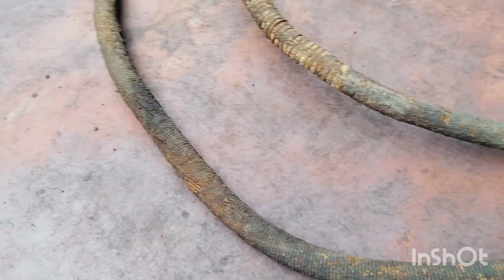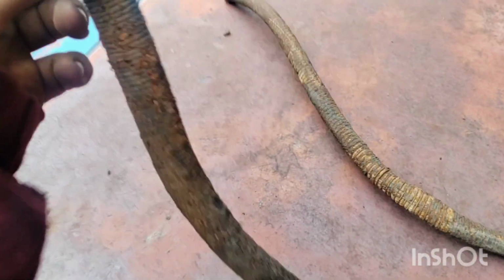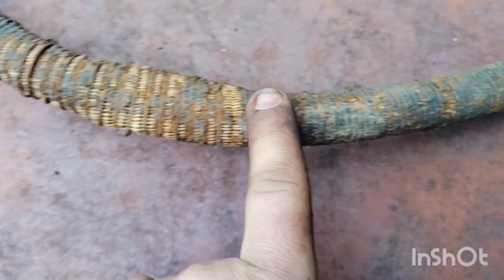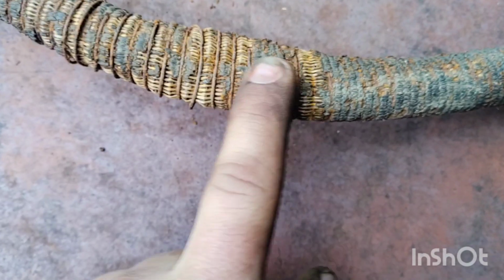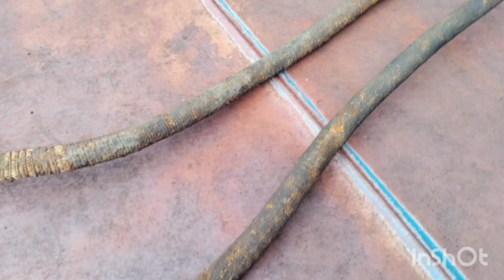They're normal rubber lines like you'd find in something like a fuel line or a return line for the hydraulic system. Even those are a bit beefier than these, but they're rubber lines wrapped in cloth and wire, just to make it a bit stronger. Now, unfortunately, what happens with these lines is the cloth holds moisture. The moisture rots out, the wires snap, your lines hemorrhage, boom goes your engine, $10,000 engine rebuild, you got a problem.